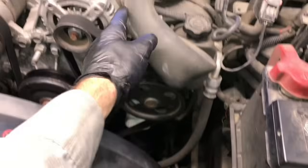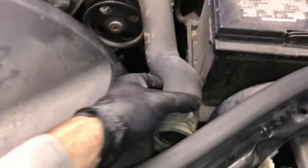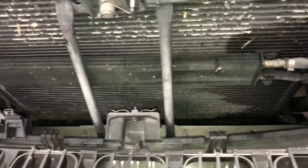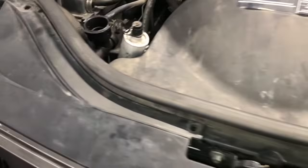Now that the fan is plugged back in and all the mounting hardware is tightened, you can take the upper radiator hose here and flip it back out over and install it onto the radiator neck. Then you can reinstall the overflow tube here, and then we can put the grill in so it hooks on the bottom here. So you hook it on the bottom and then you rotate it into position, and it'll start all the plastic clips and resecure the grill.